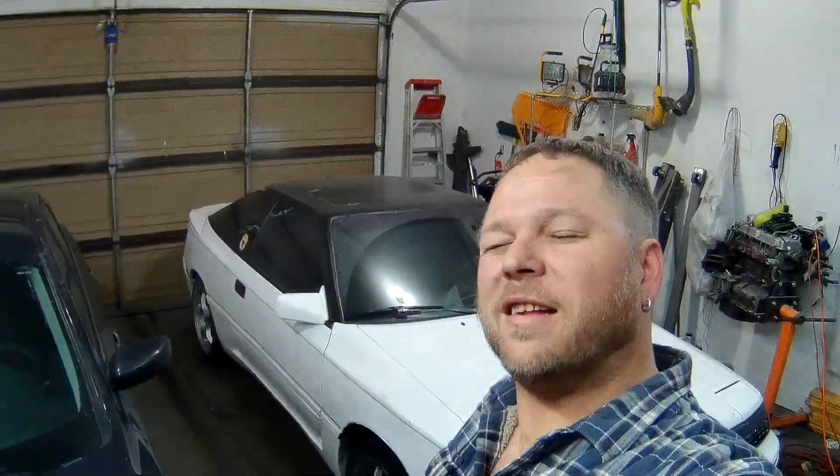It looks like I get to close out this video on a positive note — the 1MZ hack worked to get rid of the check engine light. It didn't fix anything, just got rid of the light because the wiring under the intake manifold is toast. Just a friendly reminder: do it at your own risk, because taking the knock sensors out of the equation could cause engine damage. In this case I didn't worry — it's got 300-plus thousand miles, and there are signs of a small head gasket leak, but we just want to keep the car going.